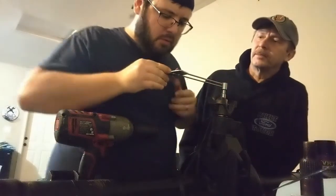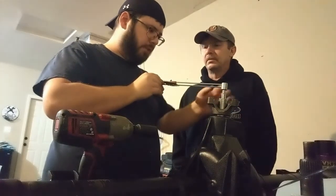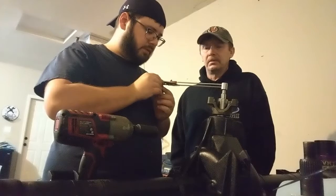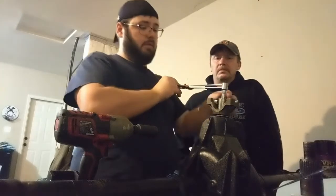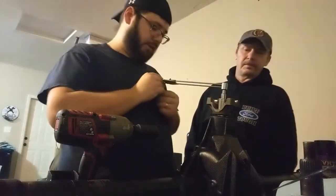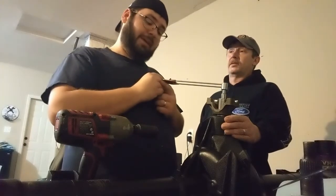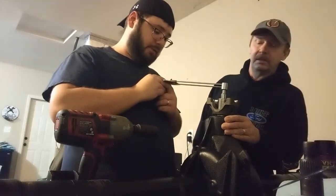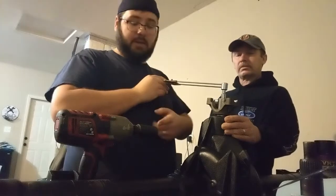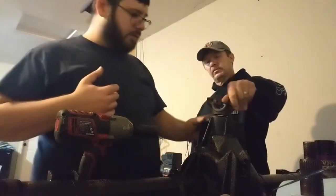Holy crap, I took a big jump. You gotta go by the breakaway, so you go until it starts breaking loose. It's about 19, so I stopped right there. I think we're about 20. I might call her good there. Because that jump from 5 to 20 was real quick. I knew that was going to happen. When the preload starts coming on, it comes on real quick. That's why they say not to do what I did. But I think we got her, dudes.